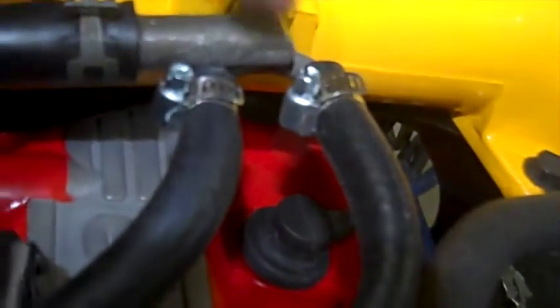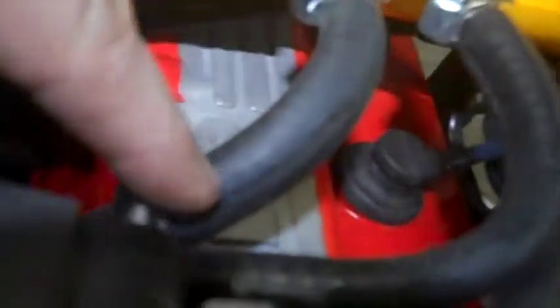From the IAC, a water hose comes out, goes under this air hose, back out right here, through a little U-turn, comes back in, and goes down into the bottom of the throttle body.